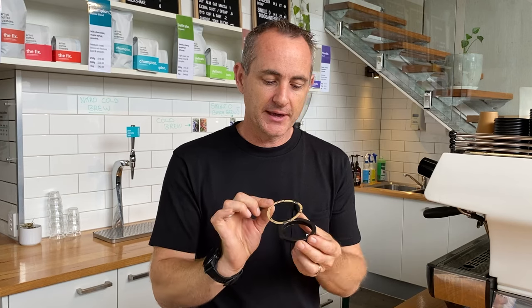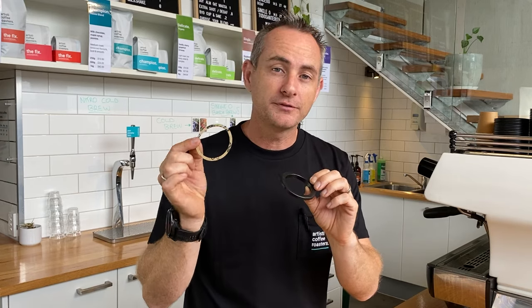If you remove your o-ring from the coffee machine and find a little paper shim, that's an identifier — it sits on top of the actual group seal as it goes up into your machine. It's a spacer, either 1mm or 0.5mm, which means the seal is going to sit lower down. Generally that means you've got a bit more wear in your machine. You can either buy the next seal in a bigger size — up to maybe 8 or 8.5mm. A normal machine would usually have a 6 or 7mm seal. If your handle's going all the way to the right, that's a good sign you need to buy a bigger one.